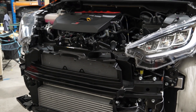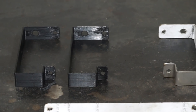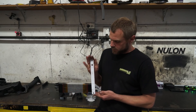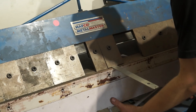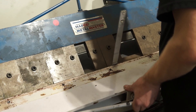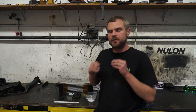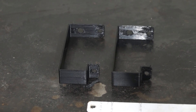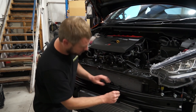Over the weekend I pulled the car apart, took measurements, then went into CAD and designed the brackets we need for the Yaris. I 3D printed them, then from those 3D prints I printed out the flat drawings on paper, glued them onto metal, and cut them out. We're going to fold these up in a minute. The key thing I like about making parts is I don't like drilling holes — the kit has to fit perfectly in the car without any compromise. These are basic folded brackets but they work as tensioners — they slip around and go over the top.